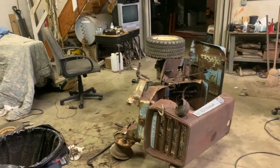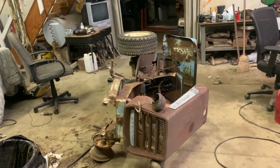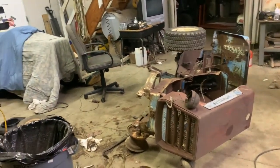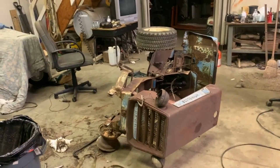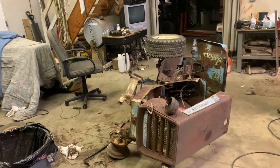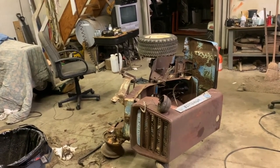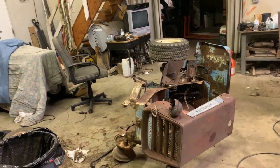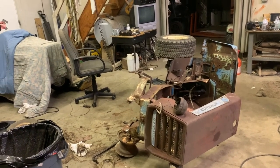We had to get the front shroud off of it, tried to get the flywheel off of it, but failed. Ended up getting the flywheel shroud off of it after having to cut the bolts. Once we cut the bolts, we were able to get in, hooked a drill up to it with a socket, and we rotated the engine and got the engine to have spark.